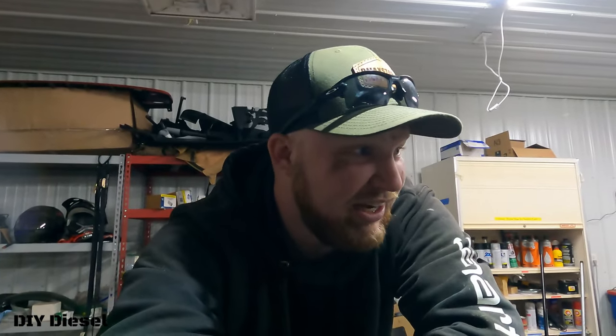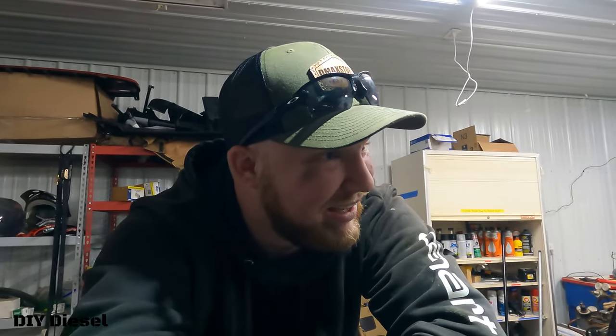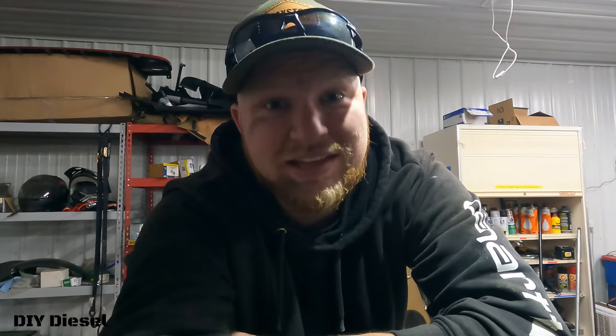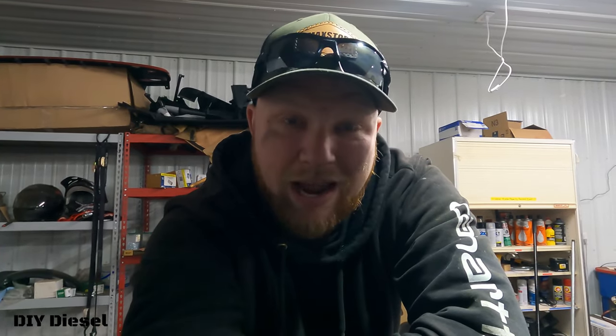I'm pulsing and squeezing the hose to get all the new coolant in. We definitely didn't need as much coolant as we bought. I'll show you shortly how many gallons of Dex-Cool we used. I'll link everything below — the Dex-Cool concentrate, distilled water, the hose kit, and all the tools we used. Then we'll put the cap on, put the bleeder screw back in, start the truck, and look for leaks.